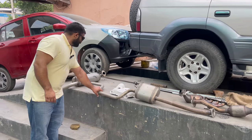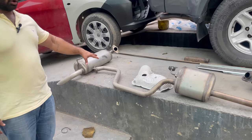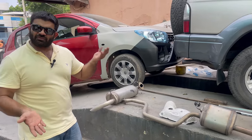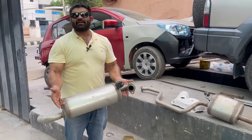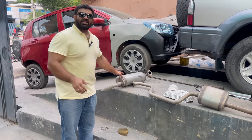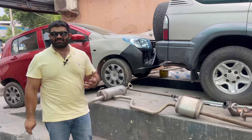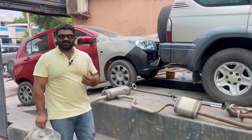From here it fits this way. This interesting hoop bend helps route the exhaust pipe over your rear differential tube and clear it, leaving space for articulation as well. And at the end is this big heavy piece — this is the secondary muffler. This has tons of glass wool stuffed into that space, and this is what actually quietens the entire exhaust system. It makes the stock Jimny sound like a refrigerator — that's all the sound there is. We thought of doing a video of how a stock Jimny sounds but there was practically nothing to record.